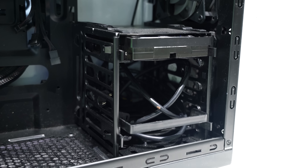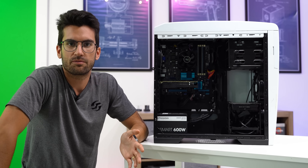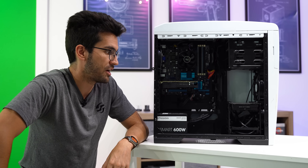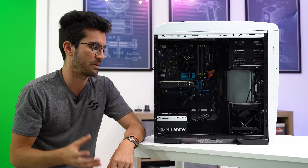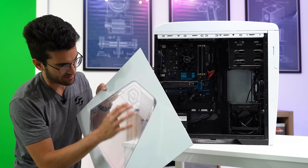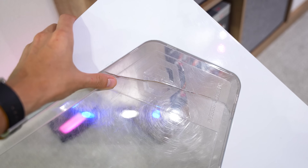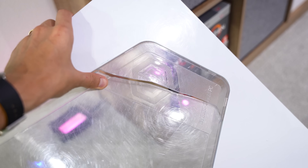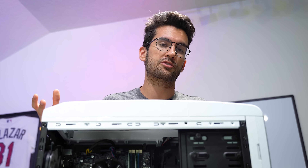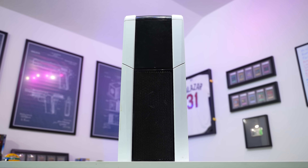along with a GTX 1050 Ti. We were looking around for storage drives. It looks like he only has a hard disk drive, which is a bit painful to see because that's going to mean that his load times and boot times are going to be a lot longer than they otherwise would be with an SSD. We'll see what else is wrong with this rig — maybe it's something we could upgrade for him. You'll notice that this case is also quite large, quite old, and it has a broken side panel. This is back when acrylic was a pretty popular side panel choice. You can see it is just scratched like mess and split all the way through. But despite the older hardware in here, this is still a viable 720p and light 1080p gaming machine. It's not e-waste. It shouldn't be scrapped.